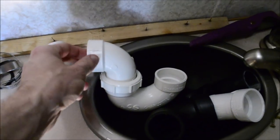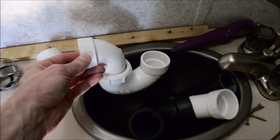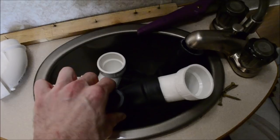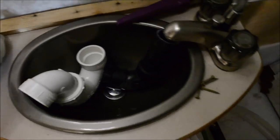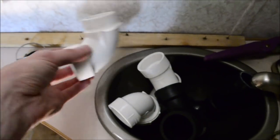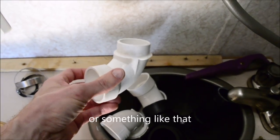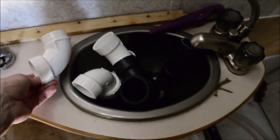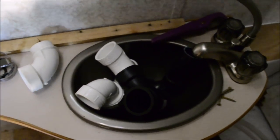Still need to cut in holes for the table and the bathroom plumbing. I'm going to add a trap to the shower drain because there was not one before. Yes, I'm mixing PVC and ABS — they don't sell ABS near me so I don't have much of a choice. I could replace all the plumbing in here, but I do not want to do that. Using rubber couplers and ABS to PVC cement — this would not fly in a house and doesn't meet plumbing code in most states. I've read that ABS and PVC expand and contract at different temperatures, so over time that might cause leaks, but I'm not really worried about it for the couple of connections I'm making. I'll be watching this for leaks.